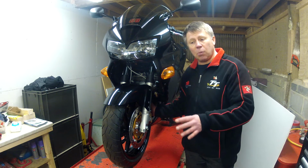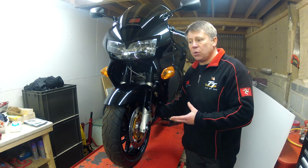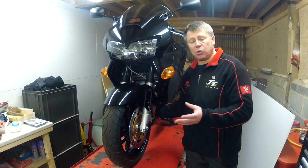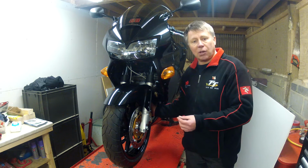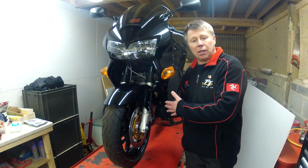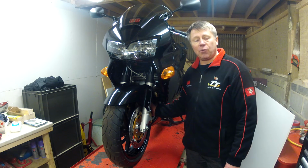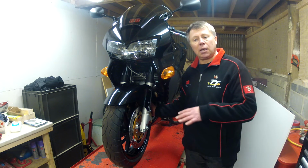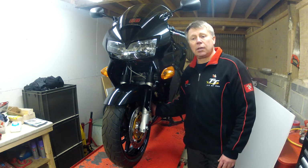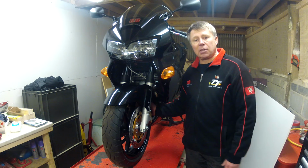There's an awful lot of plumbing and wiring up inside, and when you check the exhaust emissions with these, or you do any tuning work, you have to blank off the PAIR valve because it throws off the O2 reading. So I made some aluminium plate, about 3 or 4 millimetres, and I replaced the PAIR valve housing and got rid of all the hosing and the wiring, and it's cleaned up the engine bay considerably.